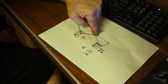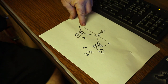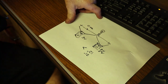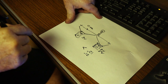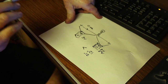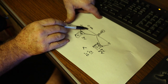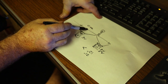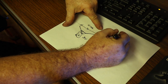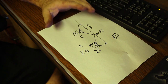This tests the whole circuit. If you see that you don't have a good connection and you have voltage drop, now your job is to find out where. You need to pull a wiring diagram — it'll show you connectors and they'll be labeled. For example, I had a Ford Expedition with a no-crank condition and a problem in the wiring connection. The ECM was trying to crank it but wasn't getting through the fuse panel to the starter relay to activate the starter solenoid. An appliance can be a starter, a relay, a light bulb, or even a sensor.